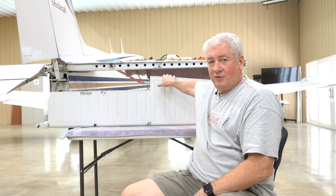Don't just monitor it and watch it, because depending on the situation it can take off. I'm doing this video today because it took off on this elevator. About two years ago I had three small spots of filiform corrosion and we treated those. Dummy me, I didn't check closely after that because I thought we'd pretty much treated it. I live in North Texas — not a humid environment — and it lives in a dehumidified hangar. But I go to Florida a lot, and it spends time outside there when it travels. Somewhere over the last year, filiform corrosion took off.